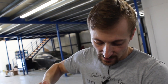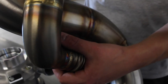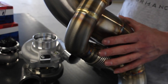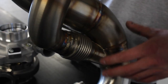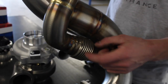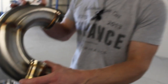We've got a flex bellows in there because wastegates really do rattle when they're open, and that's usually where you'll see a failure in the manifold or downpipe. They vibrate so much they can crack the weld joints or fatigue the stainless steel over time and you'll get a crack form. So it's really important to have this flexible joint — it gives the wastegate somewhere to go and it also aids fitment, making things a little easier to install.